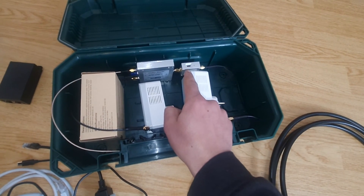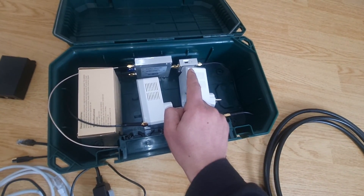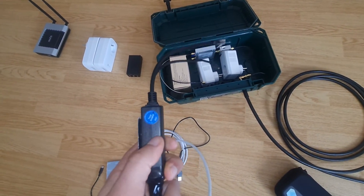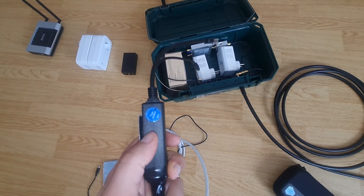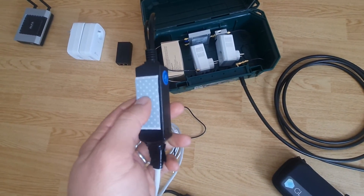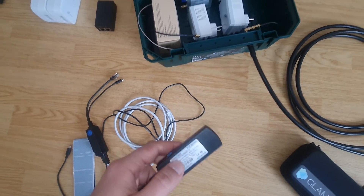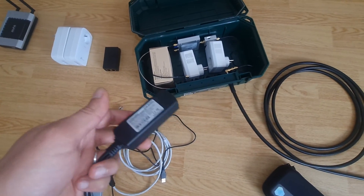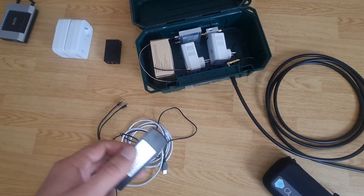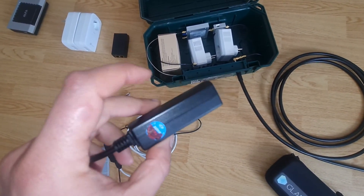That is very very important. Another thing: be careful with PoE splitters — they are limited to 100 Mbps. Read the specs carefully. There are also 1 Gigabit splitters available. My house has only 50 Mbps so I use 100 Mbps splitters, but if your connection is 1 Gig you must buy 1 Gigabit splitters. Be careful when choosing splitters.